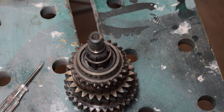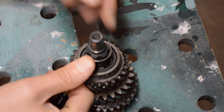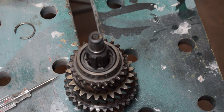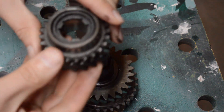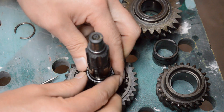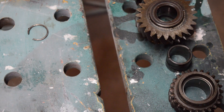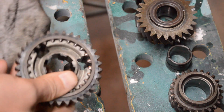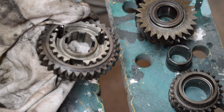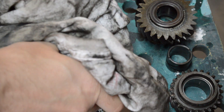That is, by far, the hardest part of this whole process. As you loosen it off, make sure it doesn't go flying. Circlip removed — the other pieces can start to come out. Quick note as you're taking everything apart: where these hubs have a piece that slides out, there are three ball bearings and springs on the inside that hold tension. Put a rag around it when you do that so you can catch all the pieces, because they can go flying.